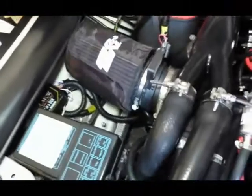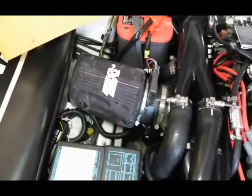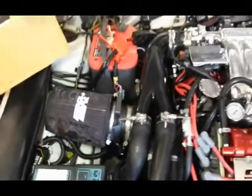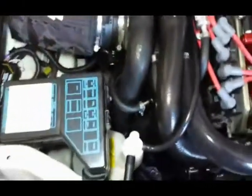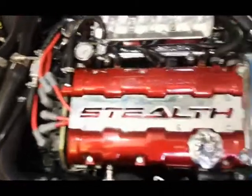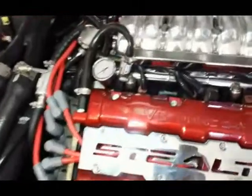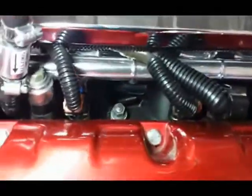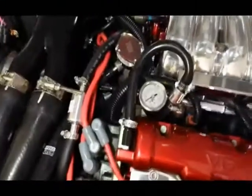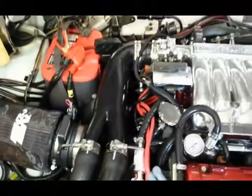So starting here on the left, we have the LS6 85mm GM MAF with translator version 2.02. DMP Y pipe, 3SX intakes painted black. We did the full Super 60K as you saw, including a new thermostat as well. Crank vents, fuel system, so FIC 1120s. As you can see, the Cerakote coated lower plenum. AM FPR. That, of course, the fuel filter, which I showed and highlighted earlier.